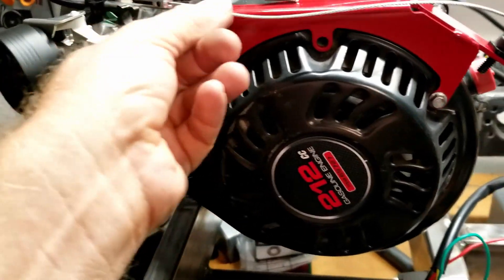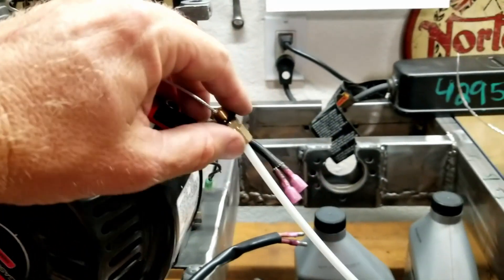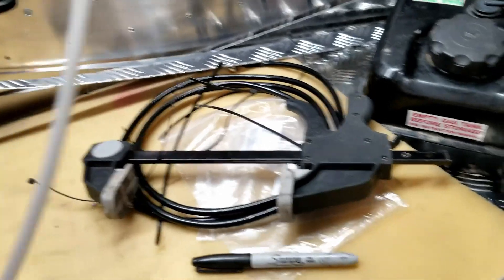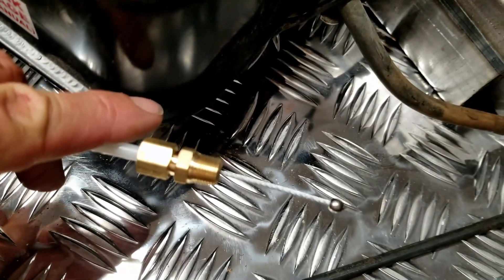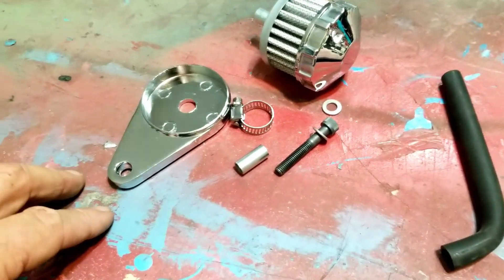This is just mocked up for now. There's a little set screw for the cable and the ferrule is tightened up in the brass piece, so the housing is locked in. Next I'll need to fish this through the body and then put a piece of quarter-inch rod, bend a 90-degree on it, hook it to the pedal, and connect it to the throttle assembly.